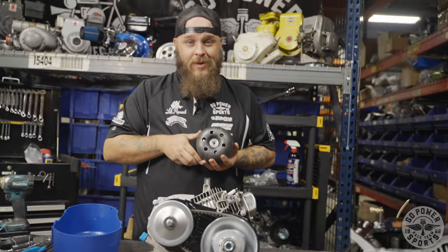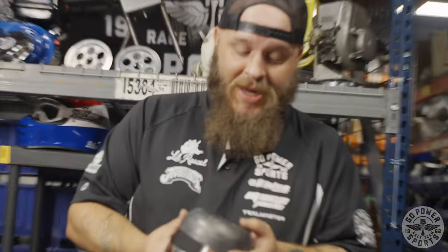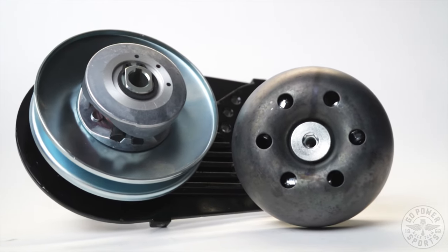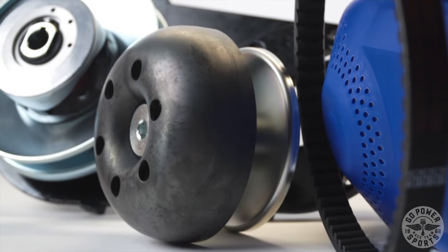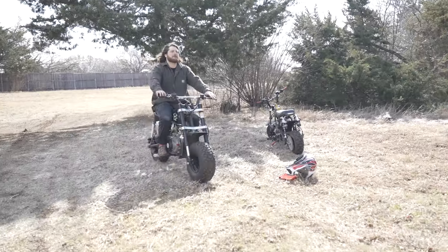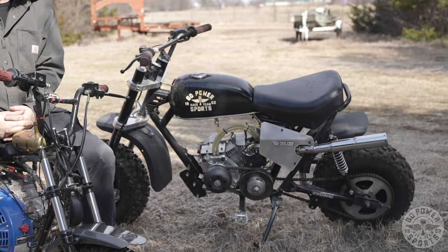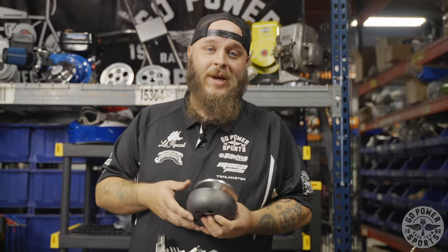The Juggernaut. The purpose for the Juggernaut is to stay hooked up through high RPMs. Where this puppy shines is about 4,000 RPM or greater, so you need to at least have an ungoverned engine. Preferably a stage two motor would be ideal for the Juggernaut. Don't go putting a Juggernaut on your stock engine and expecting a lot of results — you're just not going to get them.